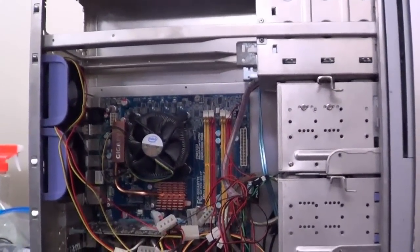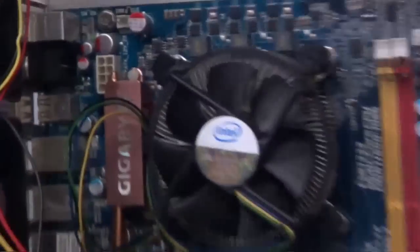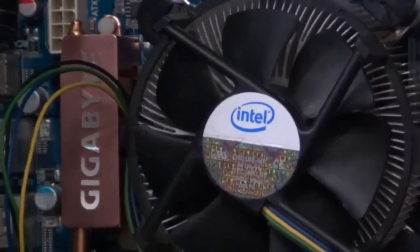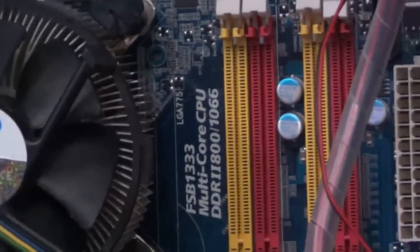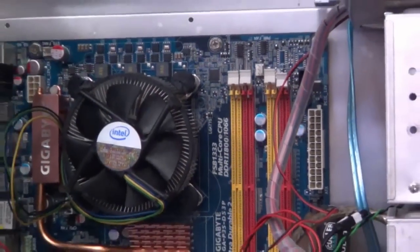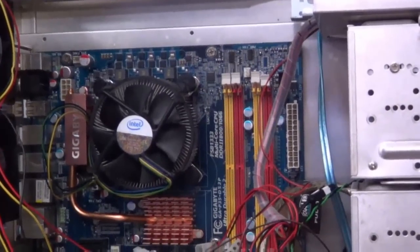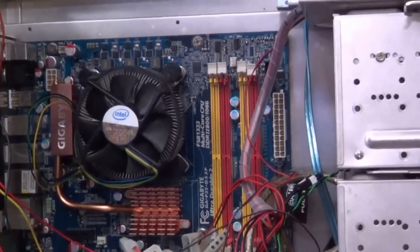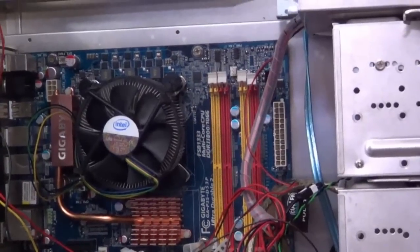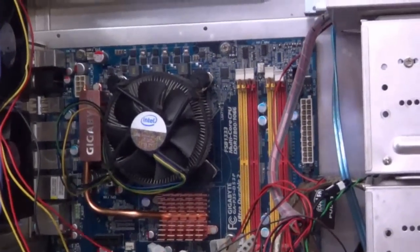The thing is, this board was already flaking out. When that all happened, I thought this would be the better of the 2 Gigabyte boards, and for a long time it was. But eventually I started having problems when I tried upgrading the RAM to bring this old system up to 4 gigs of DDR2. I didn't know if it was the Kingston RAM, but even with 2 gigs of the old Crucial stuff in here, I would still get freezes during the POST process. So even this Gigabyte board eventually started flaking out.